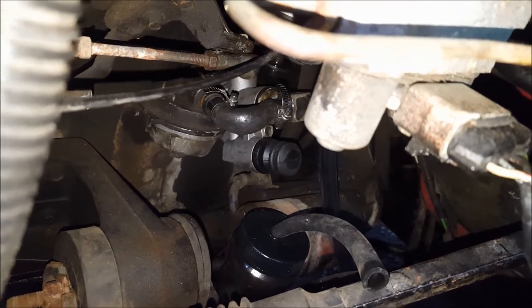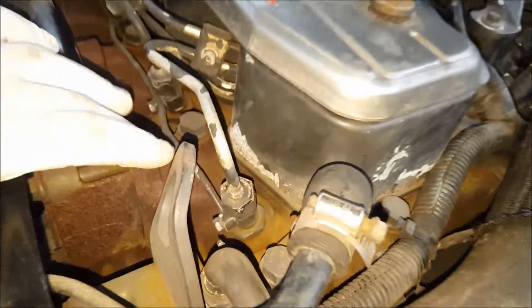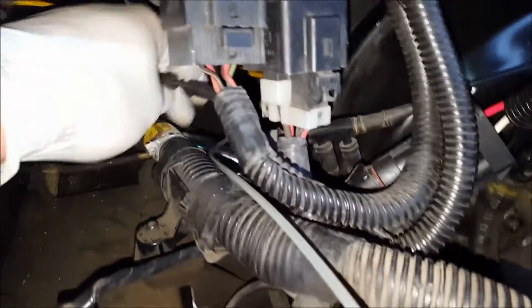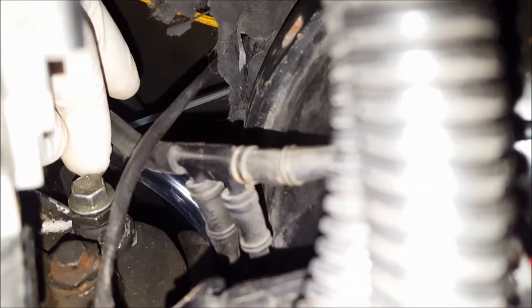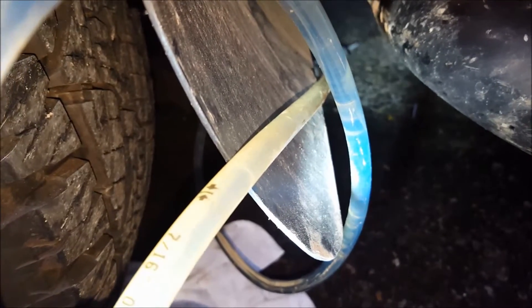I put new hose clamps on all the rubber lines — I don't have new rubber lines right now, I'll have to order those. Even after putting the new hose clamps on, I'm still getting air on the return line. Doing a little more research, I found that a bad injector cup seal inside one of these injectors could be causing combustion gases to get into the fuel return lines. So I took the banjo off where the injector return comes back over the head and tees into the fuel inlet on the fuel filter. I put a hose on that banjo and plugged off the port — threads are M8x1.25. I fired it up and even with the injector return line out of the equation, I'm still getting little air bubbles.